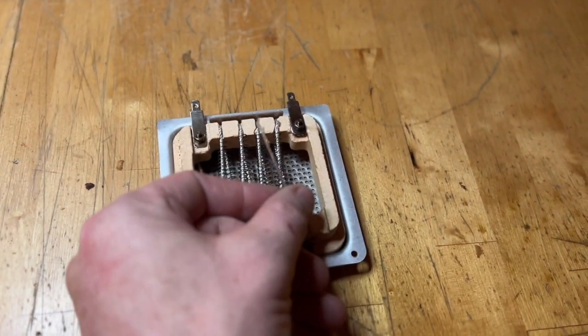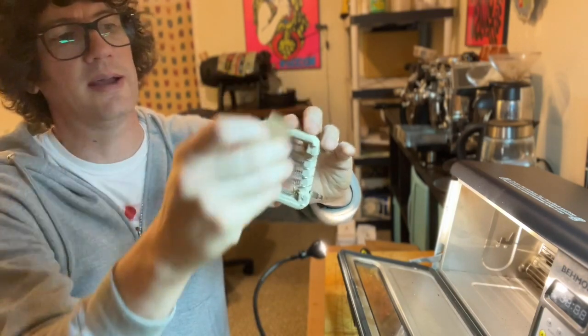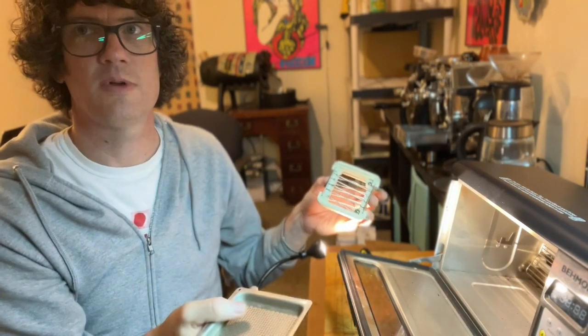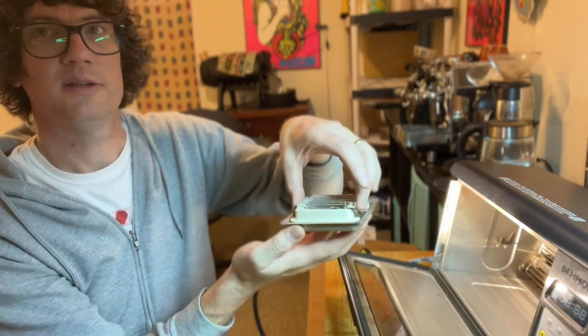It looks like we found our culprit. You may have noticed these little metal brackets — we need to slide those right back into place in the new unit. There are two little slots on both sides that they just fit right into, and these are going to hold the afterburner in place in the little tray. Now that we have that removed, we can add the new one to the tray and remount it in reverse order. Remember that the little screw holes go towards the front of the machine, and therefore the tabs need to be facing backwards. Drop this in the tray just like that. The little tabs slid in pretty easily, the spade clips are reconnected, and make sure to push the insulation up over the spade clips.